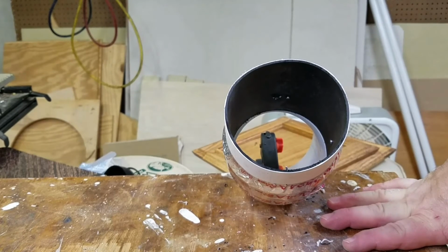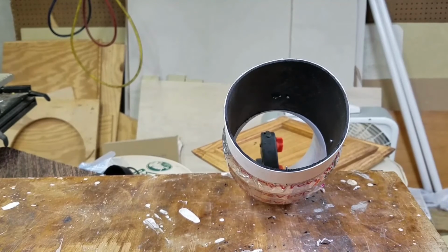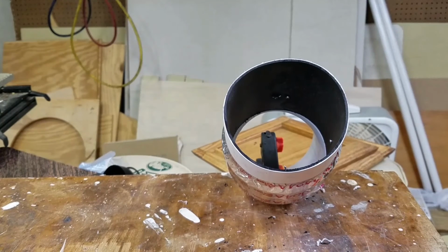I've shown you how serviceable it can be. And hey, we're talking about 4-inch sewer and drain, not Schedule 40 and not metal pipe here. And like I said, in my prior experiences, drilling rivets in metal doesn't tend to wall the hole out. Not sure why it did it in PVC, but you learn a little something new every day. So that's it. That's the video for today.